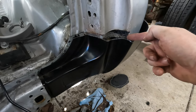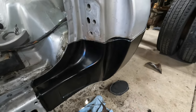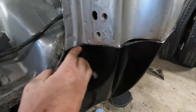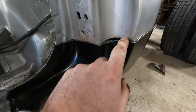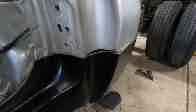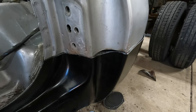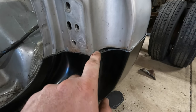You can see here how I'm going to dry fit this to make sure everything lines up. We're overlapping everything from here back, and everything from here down we're going to butt weld. I have a little bit of a mistake here — a larger gap than what I really want. That's kind of okay; we can fix it, and everything else lines up pretty decently when you tighten it all up. The options are we can lay a piece of metal behind it and either do the rivet trick and fill it in with weld, or if you're really good with a MIG welder, you can build up the edge and keep filling it in. The problem is the metal is very thin and it's really easy to overheat and warp. So we're just going to put a backer behind it and fill it in with weld.